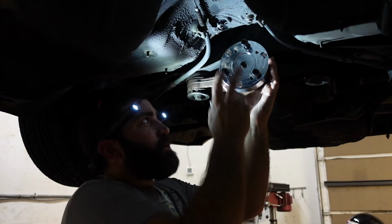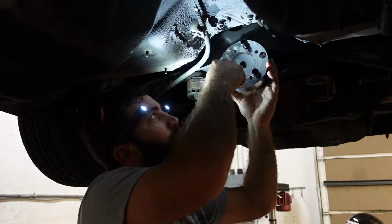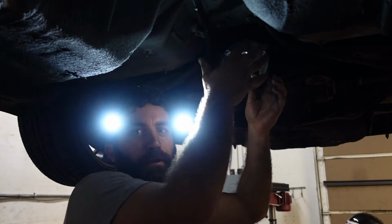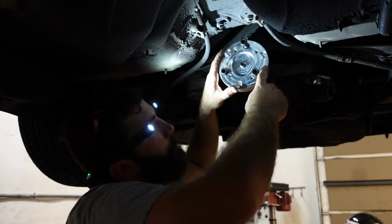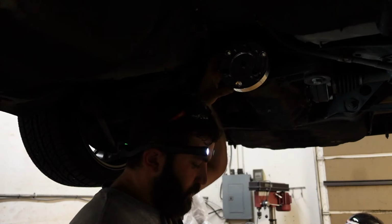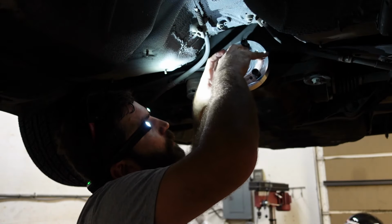Alright, so this is the drive shaft adapter, because it uses the drive shaft as a 4-bolt like typical cars, but these are like weird 3-6 bolt things. So it's called like a guibo. So this gets rid of the rubber piece, which tends to fail. So there's 2 separate bolt patterns in here.